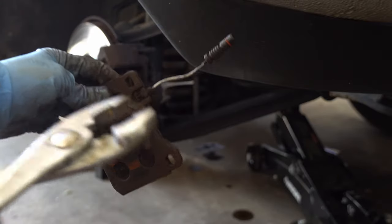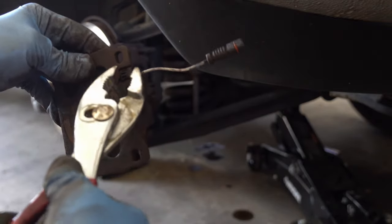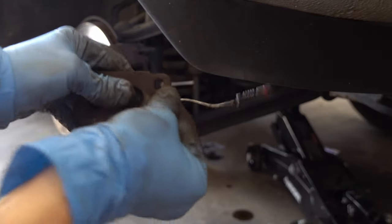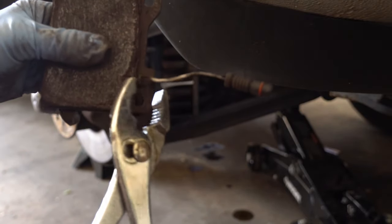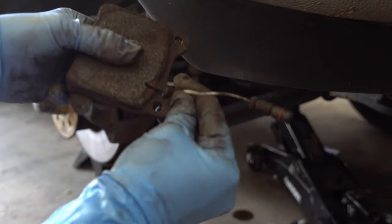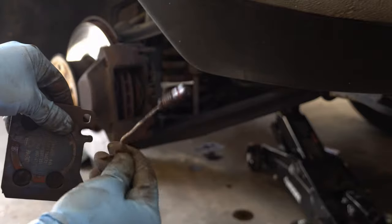As I mentioned earlier, if you feel like you can reuse the brake pad sensor or you forgot to order new ones like I did, you can still pull these old ones out as long as there's not too much wear. On the other side, you can see the pin indicator within the brake itself. There's going to be a pretty noticeable hole on the new brake pad that you can plug this back into — carefully wedge it out and be delicate with the plastic and you can pop it right into the new one.